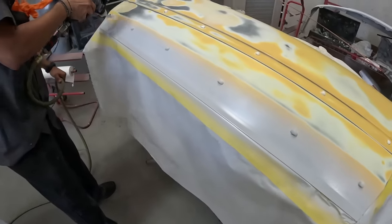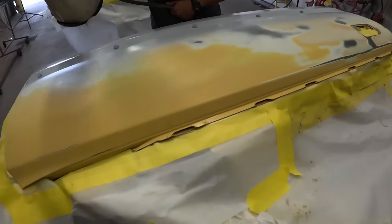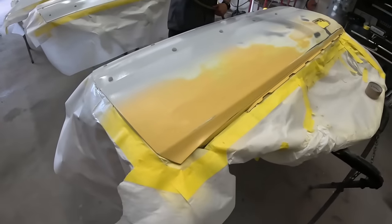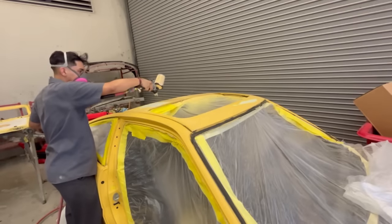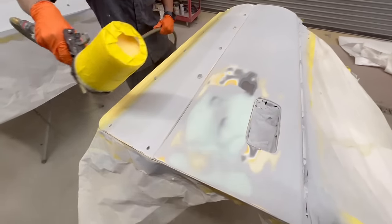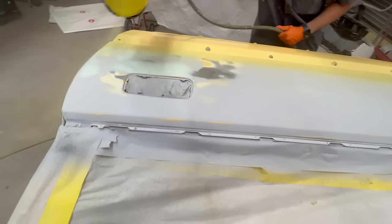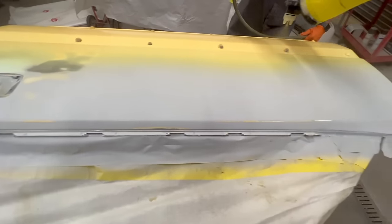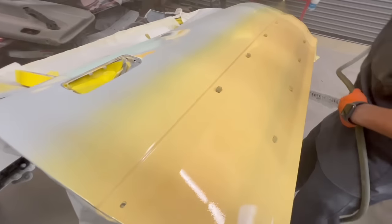Our Color Build primer can be used for sealer or primer depending on how you have mixed it up. So we're gonna start by using our Color Build primer right here on the roof, since the roof was in really good condition. It didn't need our feather fill. We got Juan going ahead and he's gonna primer the rest of the parts after we did a little bit more body work to the feather fill and to the doors and fenders and other various pieces on the vehicle.